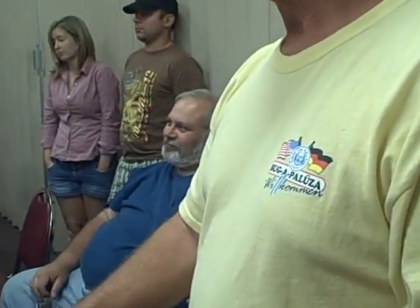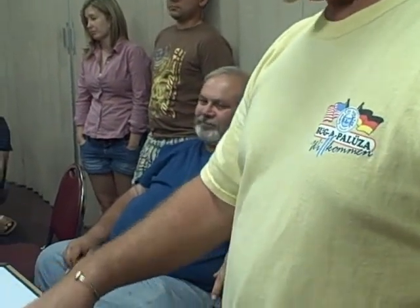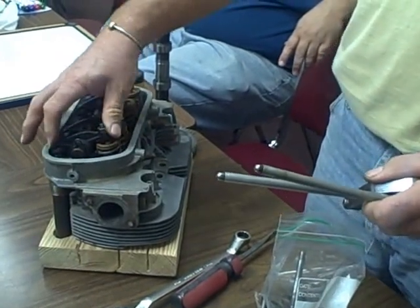Any questions on how to redo these right here? It's a lot of fun laying on your back on the concrete. It's easier to do the demo right here than it is laying on gravel. One thing I'd like to add — in case somebody tries to do it and doesn't know — you have to have the engine in the right position for each valve to do it. You turn the engine over; it has to be on top dead center for the compression stroke for the valve you're adjusting. The book How to Keep Your Volkswagen Alive has a real good section about how to do that. This was about the easiest way I could show you how to do the rocker arms and the valves and adjustment.